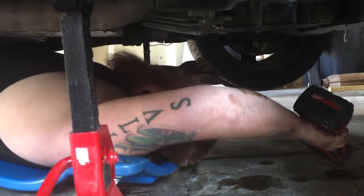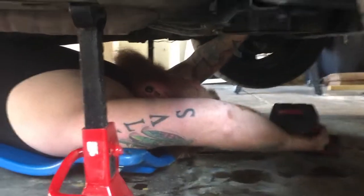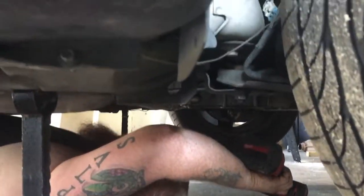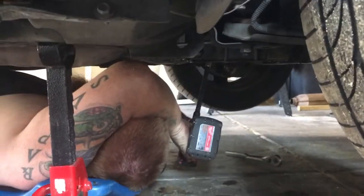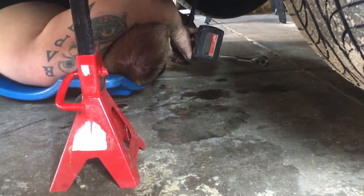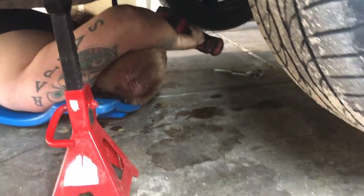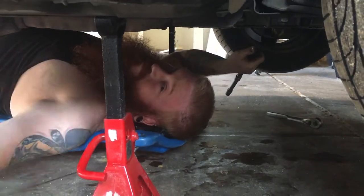So today we're putting in exhaust, full exhaust, well, headers, wait, tune-up. Valve cover. All right. Today we're doing valve cover gaskets, a full tune-up, headers, exhaust manifold gaskets, and full 2.5 inch exhaust. If you remember the other video where we did the little snake tail exhaust, that'll give you a before of what it sounds like. And then we'll obviously do an after once she's done.